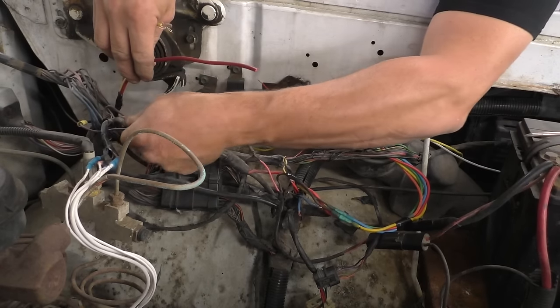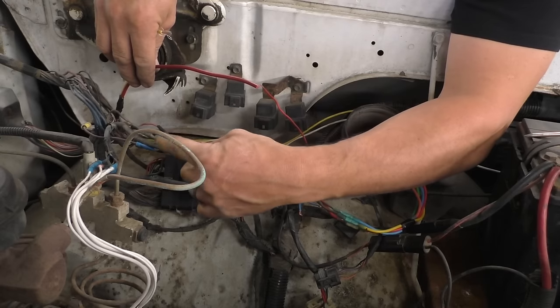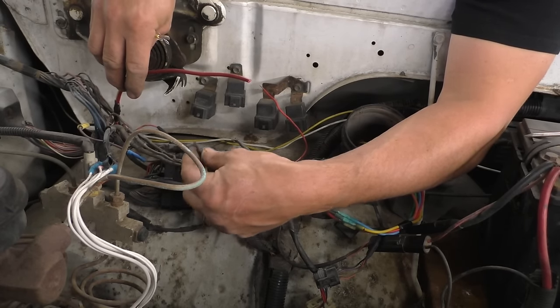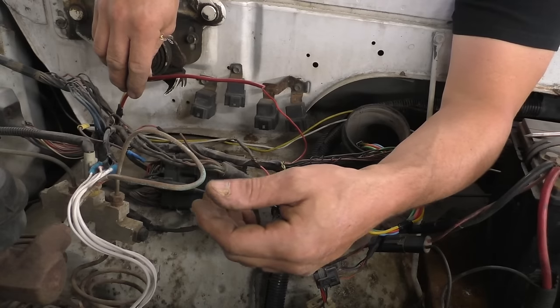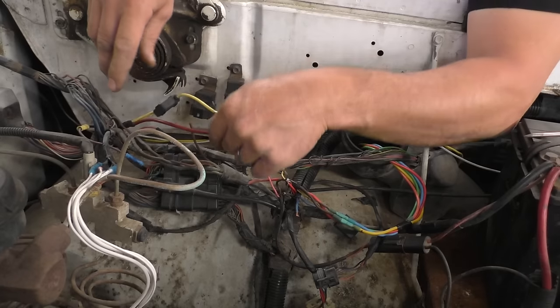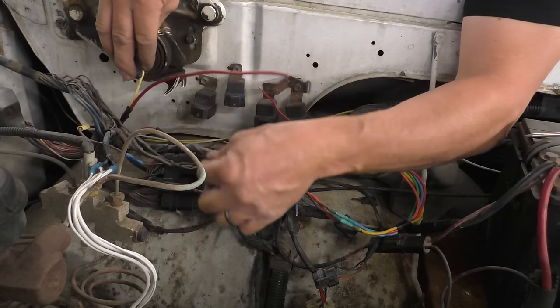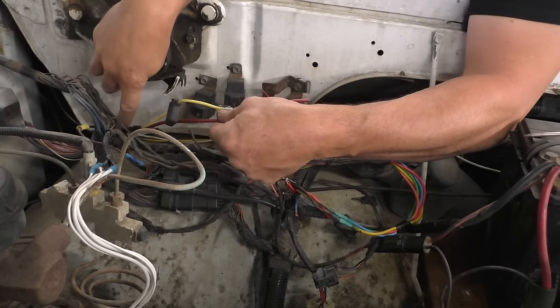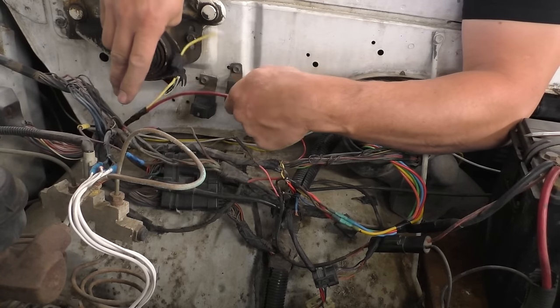I can't remember how it goes with fusible link wire. I think it's 2 or 3 gauges higher than the wire that it's hooking to. I do believe it's manufacturer specific, as far as color code. But what we're gonna do is, we know the orange fuse link went to this 10 gauge red wire that goes to the ignition switch, supposedly.